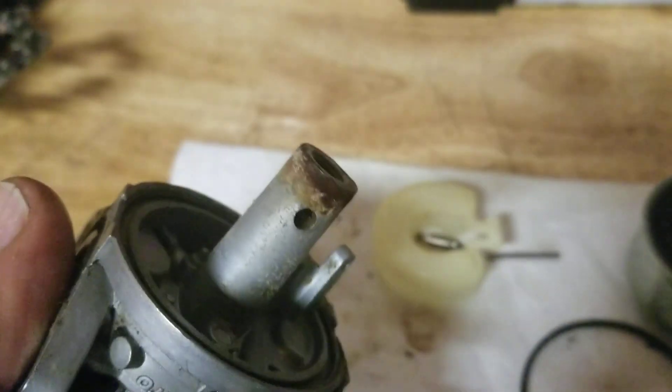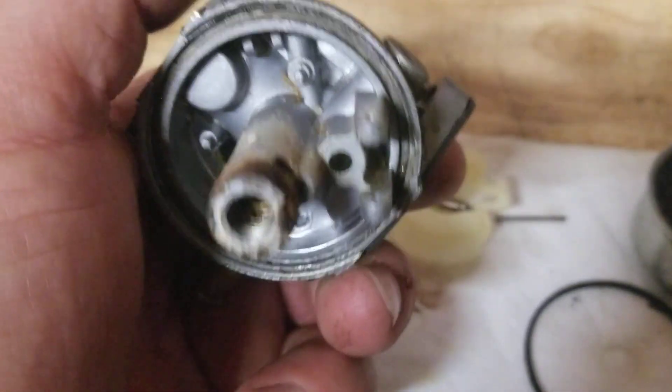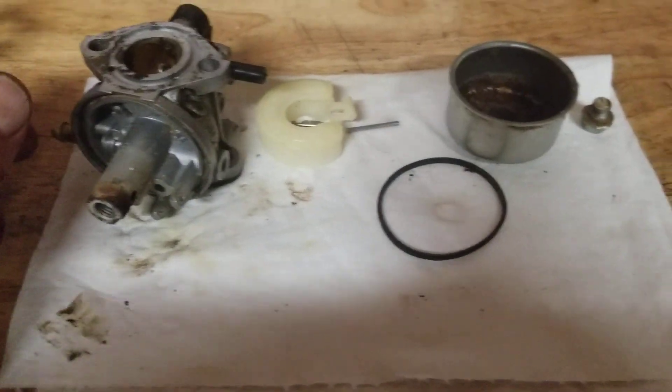Just the carburetor — I'll wire brush all the heavy stuff off. A year and a half ago it should have been running it weekly or monthly. The gas goes stale too, so I've got to dump that.